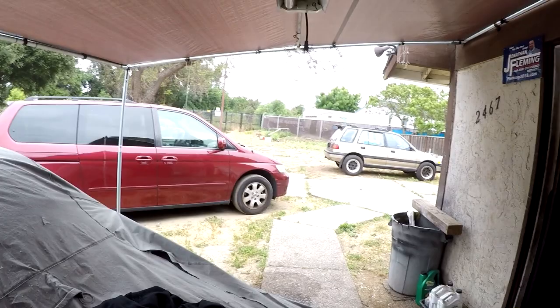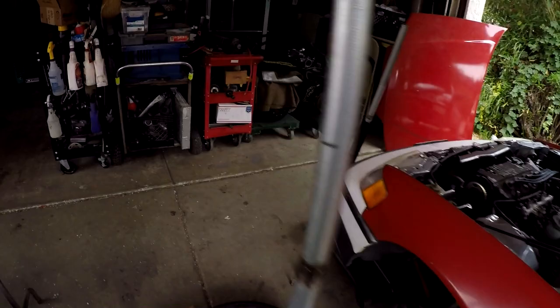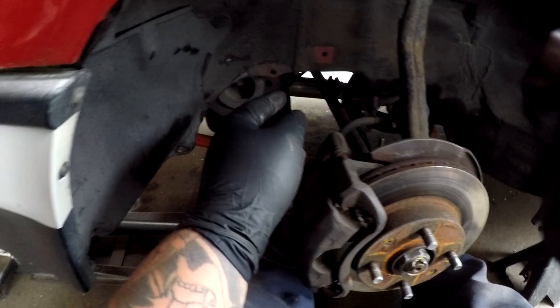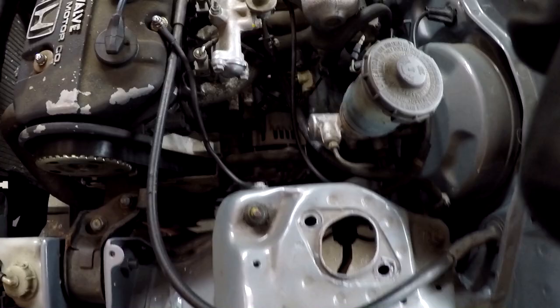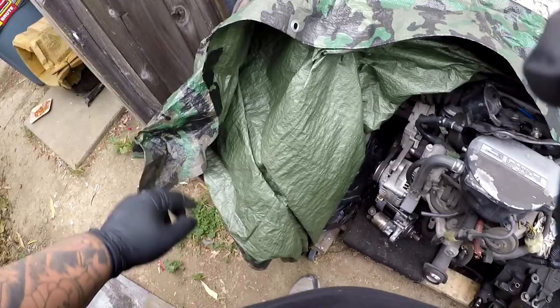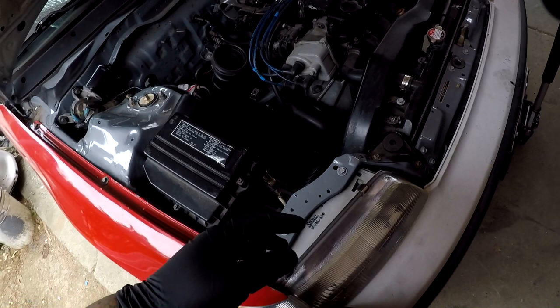I don't know where the stock suspension came from. What I'm going to do while working on the front suspension is pop the lower ball joint out, then pop the axle out of the transmission — that's probably the easiest way to drop the alternator without removing hoses on the other side. The motor in the backyard is a rebuilt engine from my brother's B20 VTEC wagon and it has a new alternator. I'll snag that one, swap it in, put a jumper pack on it, kick the car on, and let the new alternator charge the battery. Yesterday the voltmeter was only reading 13 instead of 14 volts, so I'm almost certain the alternator is the whole issue.